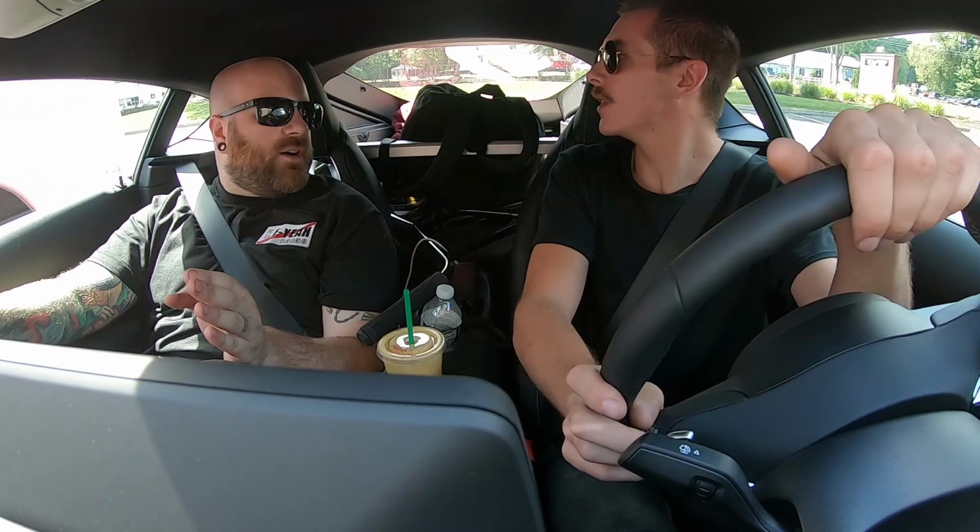So I'm curious. How do you like the auto versus all your other cars? Because you know, you drive manual. That's the biggest thing, right? So it's good, but my biggest complaint, and I don't know if there's a way around this, is I'll turn traction control off, and I have it in sport, but what I struggle with, if I'm in manual and let's say I'm spinning, if it touches the rev limiter, it still ends up shifting, and then I shift and then it double shifts. So I shift two up. So it kind of screws me.